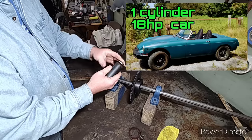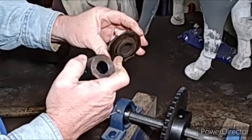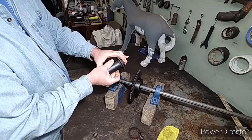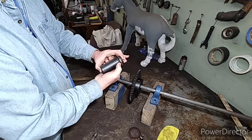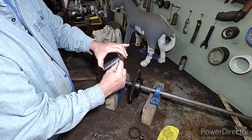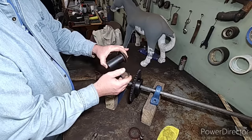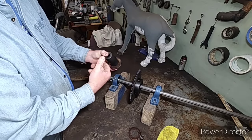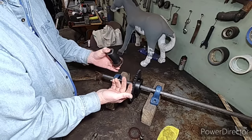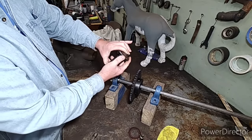If you don't have access to a machine shop, here's your other option. You can see how close the rim of the clutch eye and the coupler are — on the wrecker they were about that close. I trued it up as best I could, measured the gap, put it in the vise, tack welded it, spun it, and it looked good. I put it on the truck, been driving it around, and it doesn't have any wobble. It's an 8-to-1 ratio so it doesn't spin very fast either.